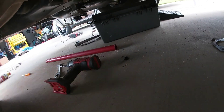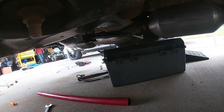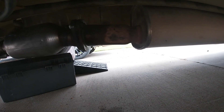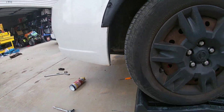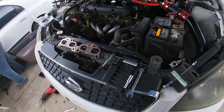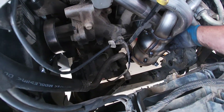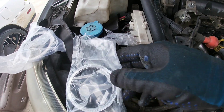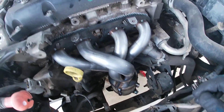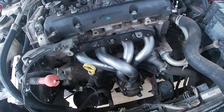We got the bottom of cat number two connected on the back end to the muffler and the hanger just slides in. Make sure you put that gasket in there. We're working our way to the front and we haven't tightened everything up yet — making sure everything fits correctly and lines up before tightening so we don't have problems. Next, get down to the bottom in between cat number one and the pipes of cat number two — make sure you put your donut gasket in there — then tighten those up and come back to tighten up the top.